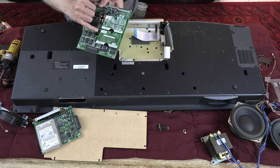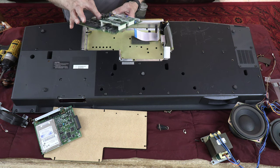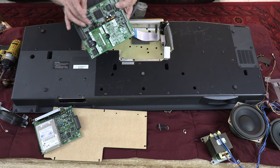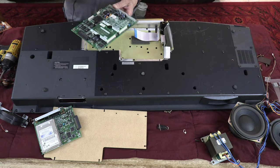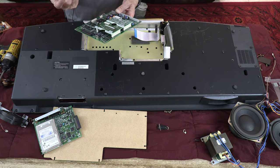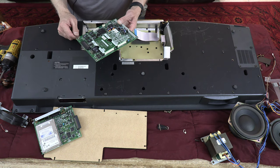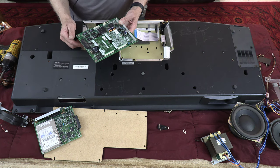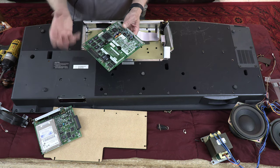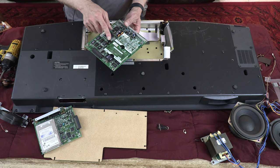These are your BIOS batteries, or I should say the clock battery. These are usually soldered to the board. They're either lithium battery or nickel cadmium batteries, rechargeables. They have to be always alive and powered in order for the chips to keep the memory alive. Otherwise, the songs that you have stored may be deleted, unless it's on, you know, the type of chips. You know, there's a random access memory and then read-only memory. Different types of chips hold the information. Some only hold the information as long as there is electricity available.